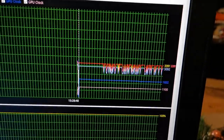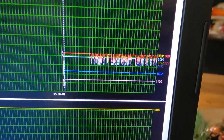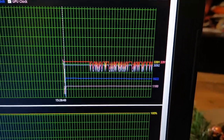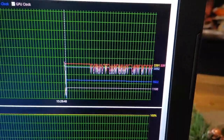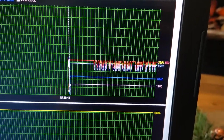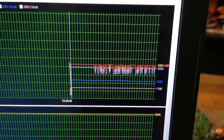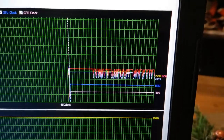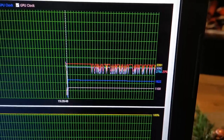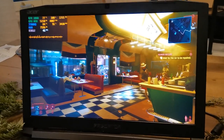The clocks show the system was stable at the beginning and stayed stable longer than without undervolting, so undervolting definitely helped. This AIDA64 test is extremely demanding for the CPU, so the next step is to fire up Cyberpunk 2077 to see how the CPU handles the boost clock under a real gaming load. With undervolting and fans at max speed, I think it should be able to maintain a stable 3.4 GHz boost on all cores.